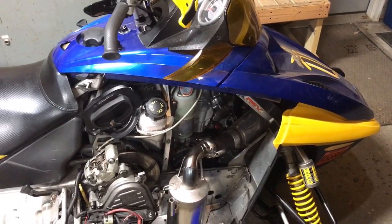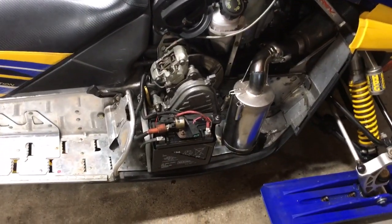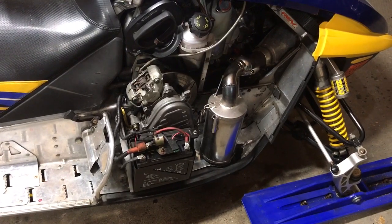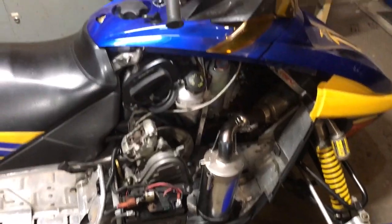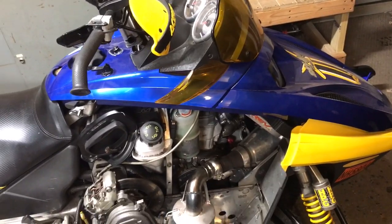That read good. So I put it all back together, bought a brand new battery, put it all back together, hit the key, it fired right up. Volts were good, volts climbed as I accelerated, no more dimming of the headlights. Problem fixed. And it was nothing more than just your old battery — just shorted out or something. I think it was shorting out my whole system.